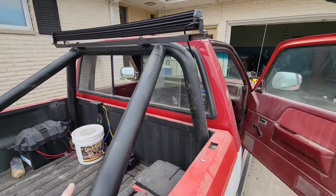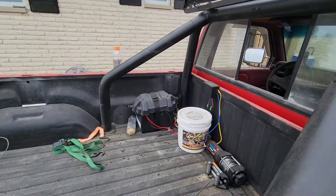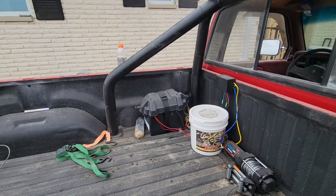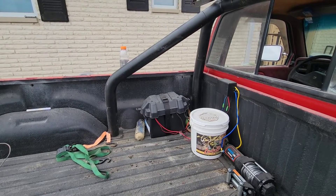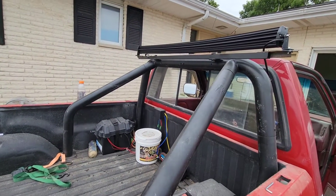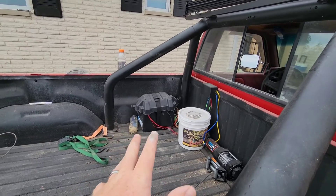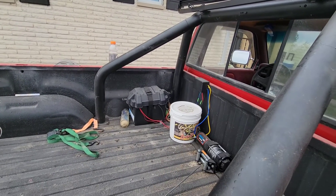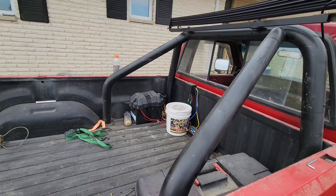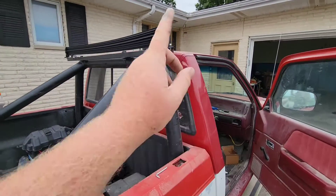So I'm probably going to run the wiring here, probably get the other lights on, then we'll go ahead and see how everything works. I have not gotten an inline fuse yet for these two bulbs that are going to be facing backwards. I'll probably just temporarily put it on the power side of that — I'm not even going to put a terminal end on the wire, because I'm going to have to snip it off anyway. Just make sure it works as it sits, and then I'll go ahead and see where we're at. Because then, obviously, I have to get the fuse. Like I've stressed before, if you listen to anything I say, put a fuse on your lights, subs — don't care what it is. Just put some electronic in a vehicle, put a fuse on it. That's why I'm going to temporarily just make sure it works. If it works, then I'm going to get an inline fuse, and then we'll be off to the races, and this thing will be finished up.